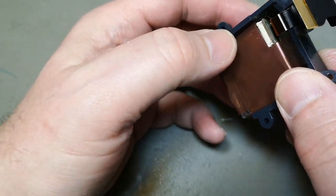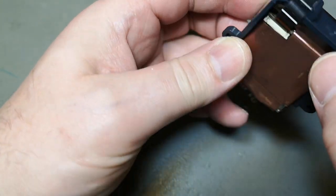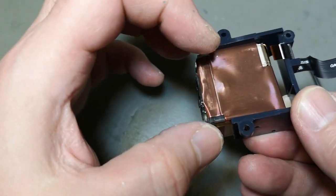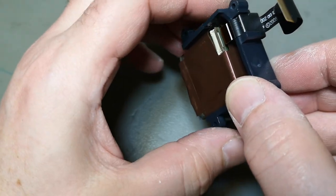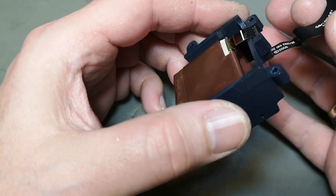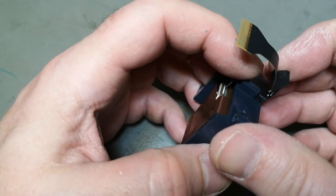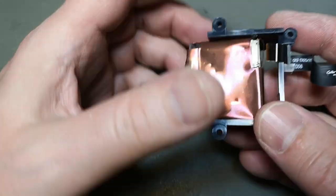Oh, look at that. So here's another connector for the camera, and then ferrite shielding. And this is again, of course, all super, super highly active in here. So they try to shield it so it's not radiating anything. And then with this ferrite, they try to stop this part of the cable from acting like an antenna for all the active goody-goody in here. So that is why you have the ferrite as close to the emitter as possible. Classic way to do that.